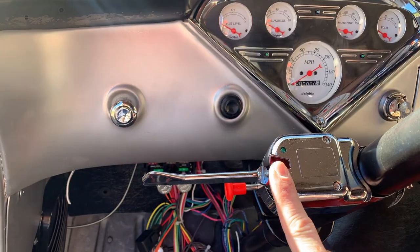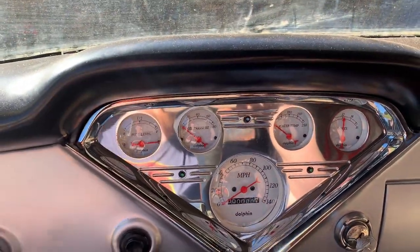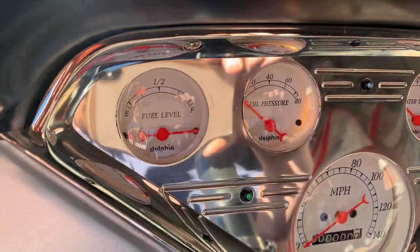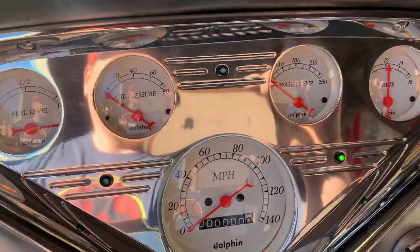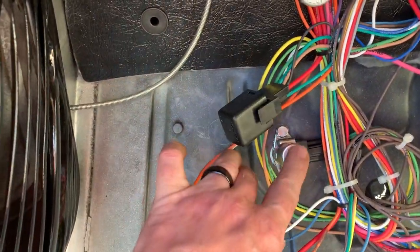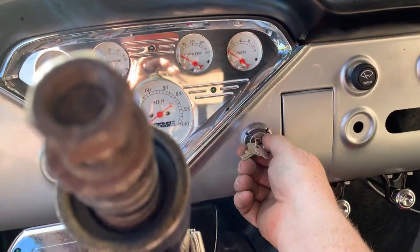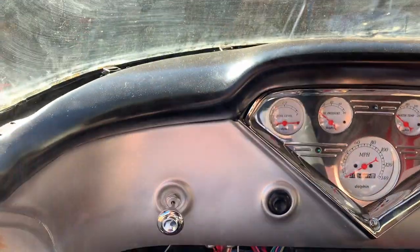Throw a little power to it. Got the turn signal switch wired in, then turn the power on — you can see there is power going to the gauges. Turn the lights on — it's probably bright but you can see that. Left and right indicator, and even the high beam indicator works — just the little foot pedal thing. So all of that is working, and even the ignition. The motor will turn over but we haven't gotten that far yet — we still need to run the gas tank and fuel lines. Once that's done, this baby should fire up. So in the next episode you should see this thing getting fuel delivered to the motor and its first fire up. Be sure to stay tuned for that — I'll see you next time guys, peace.